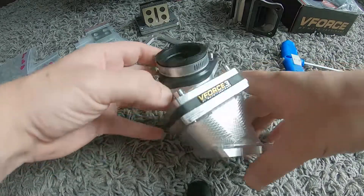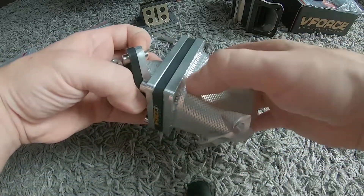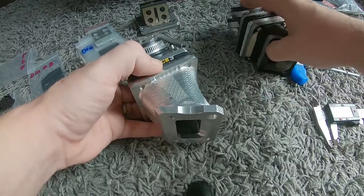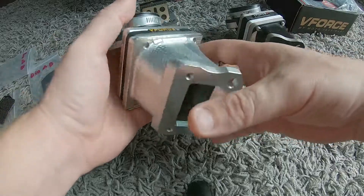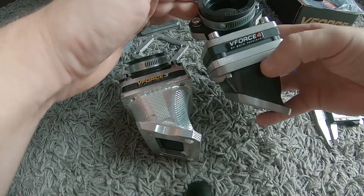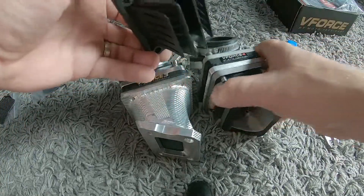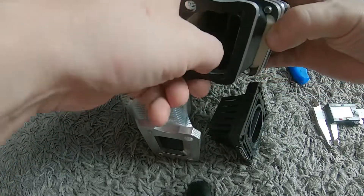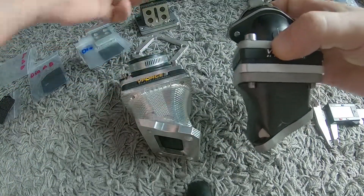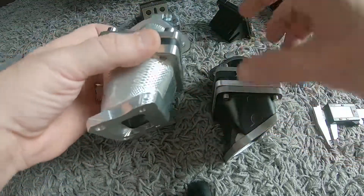Next, let's take a look at this — it's a really new product here in Thailand. It's made by a local guy. You can see it's got a pretty interesting texture. We'll do a comparison with the TWH big black manifold. The reason why he made it is because if you buy the TWH stroker manifold, the V-force reed blocks don't fit directly in — you have to cut out and hog out a lot of material so the V-force reed cage will drop in. With this one, you don't need to do any of that. It's already pre-designed to take V-force 3 and V-force 4.